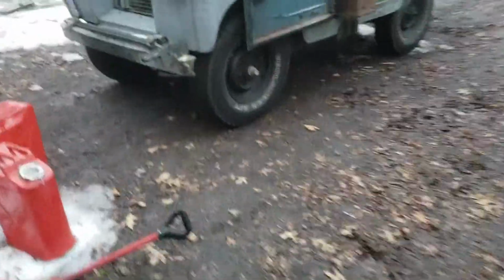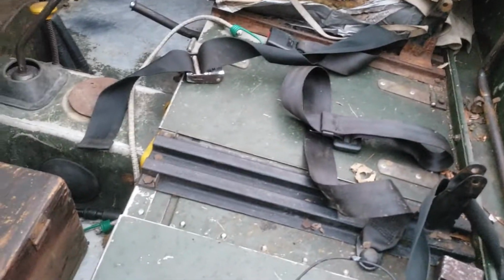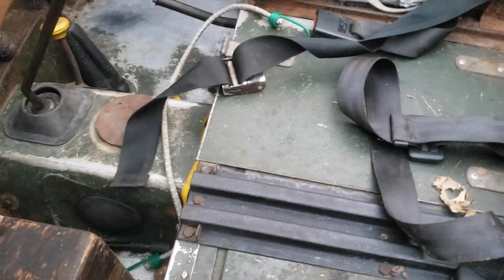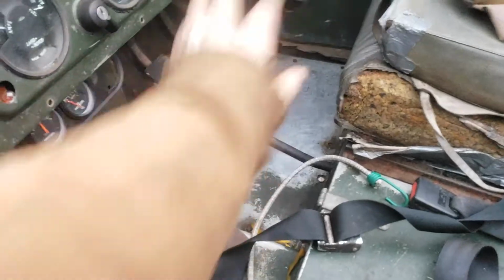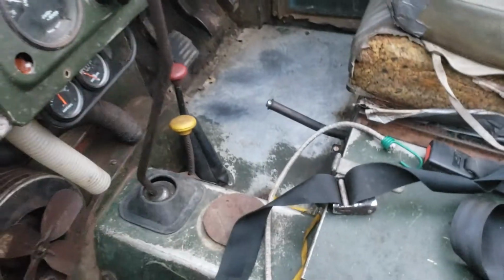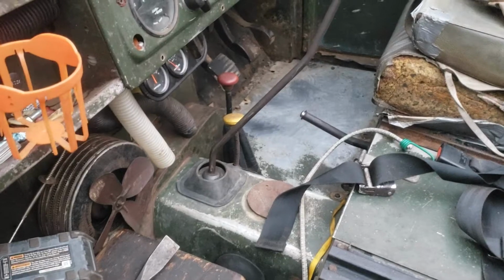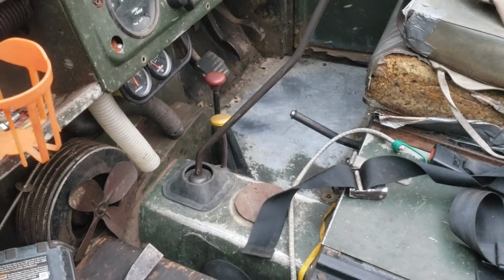I also want to say that the gearbox that's in my car right now, oh my god, it's so nice. It's very, very smooth shifting. I thought with my original gearbox that I was just not good enough at the double declutching and whatever, but this one shifts so much nicer. Those splines must have been pretty knackered in mine to get it to shift not quite right in first and second, even when I double clutched. The reverse gate works properly. So now there's quite a bit of force, and I won't be slamming it into reverse by accident. I actually have put it into first a couple times instead of reverse on accident. Luckily, I didn't slam into anything or whatever.